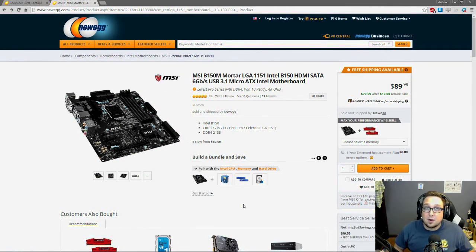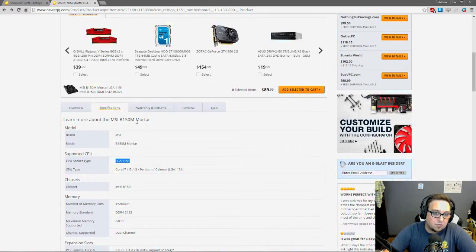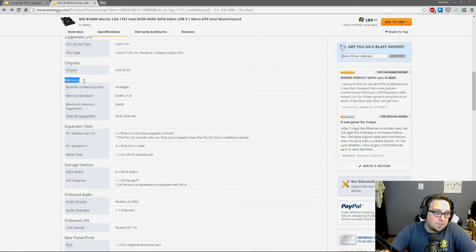There are a few things to look at and write down when picking out your motherboard so you know other things will be compatible with it. Scroll down and check out the memory type. The three big things to look for under memory are: the type of memory it uses, the speed at which the memory runs, and the number of pins. In this case the type is DDR4 — the other common type is DDR3. The speed is a four-digit number; here it's 2133. And this board uses 288-pin RAM.